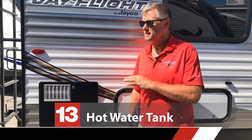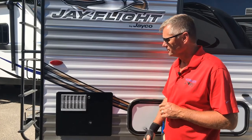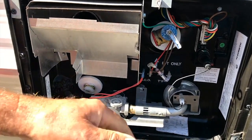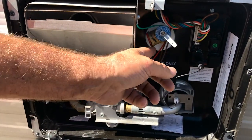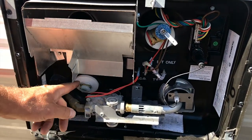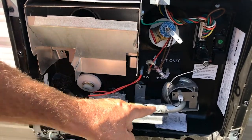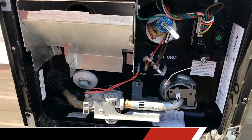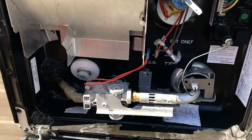Now we're at the rear of the trailer on the passenger side, where the hot water tank is located on this particular unit. Here's the outer face of the hot water tank. This is the P&T valve — the pressure temperature relief valve. I just want to toggle it a little bit just to make sure that there's water in the tank; if there's water up here, the tank has to be full. The only way to get water out of the tank now is to remove this plug and let it drain. This one is gas and electric — here's the gas controls. The electric element is on the back of the tank. This is an Atwood, so it's just a plug in here. There's no anode rod — that's on a Suburban tank.